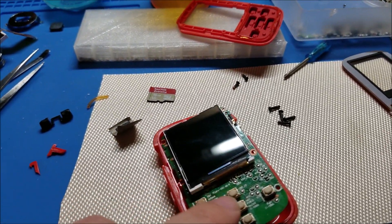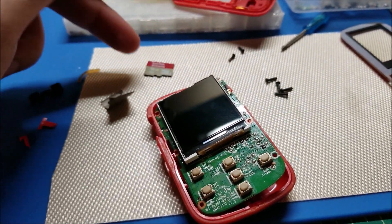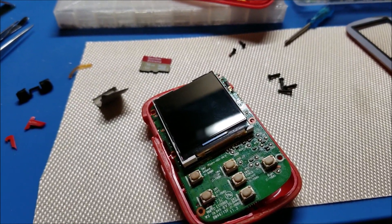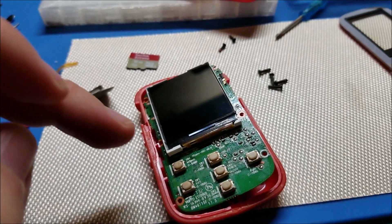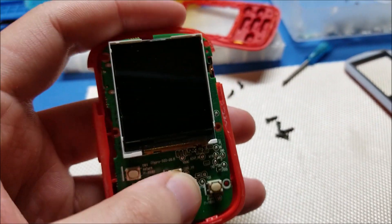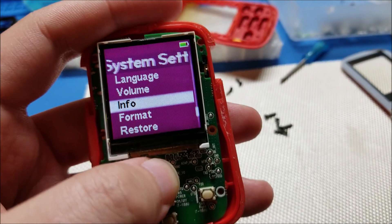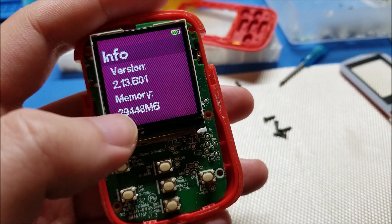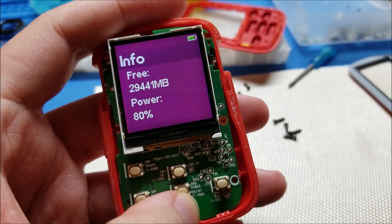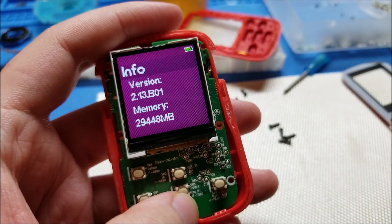So I created an image and then I imaged that to the card, and it booted. But it still said it was 16 gigabytes, clearly because the image was a 16-gigabyte image. There was a lot of memory that wasn't part of that partition, so the player couldn't see it. All I had to do is go into the settings of the player and reformat. And all of a sudden I have 32 gigabytes. If I go to info, it says 29 and a half gigabytes, which is basically 32 formatted. And I have my songs — I had to re-put all my music back on obviously because I had to reformat it.